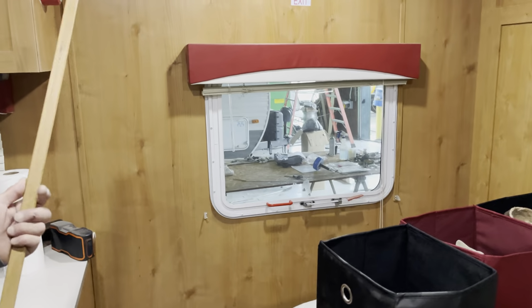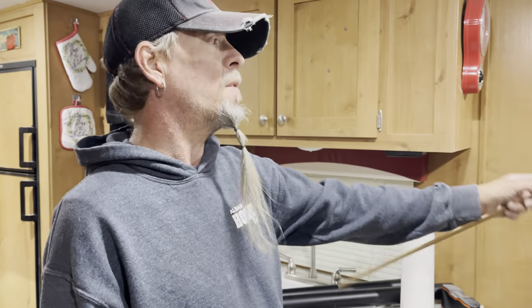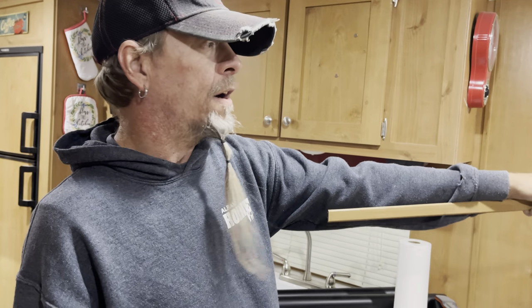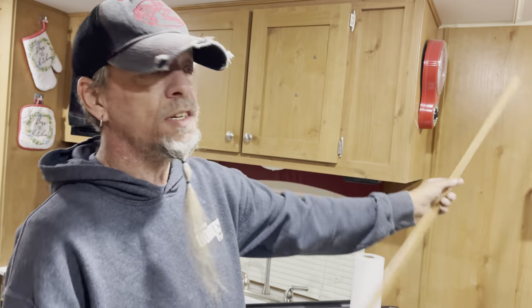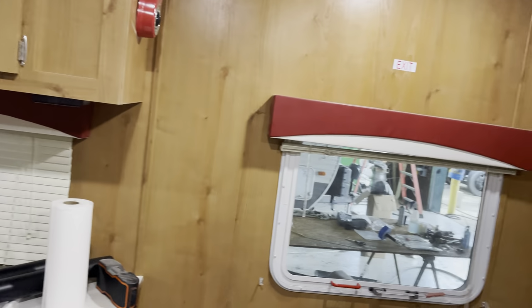And I was actually, when you were talking about the possibility of condensation coming out of the window. Yeah, that's what our biggest concern was with that. I will go out there and just be sure that on these front windows they have sealant around. Because sometimes they'll use a foam gasket in between. But on a corrugated metal unit like this, you have to seal it. You can't not seal it because it shifts. I just don't trust the foam gasket thing. Well, you would know because you're the one dealing with all the issues it causes, right? Right. Well, like I said, we'll just make sure that it's sealed up really nice.